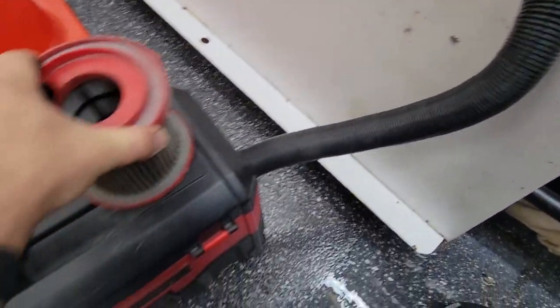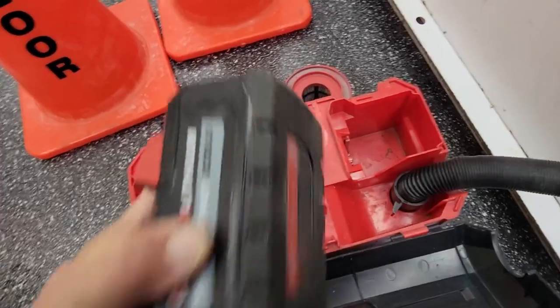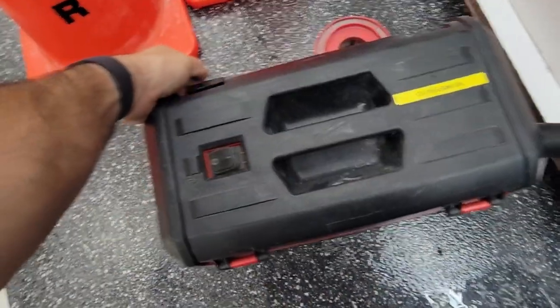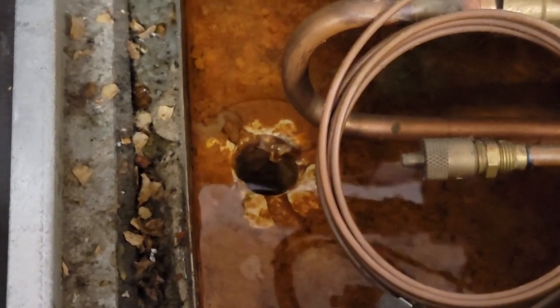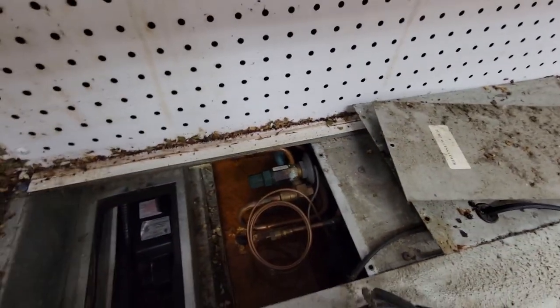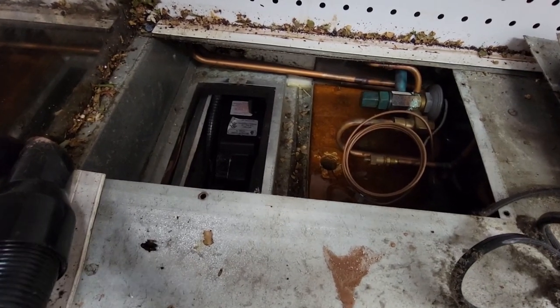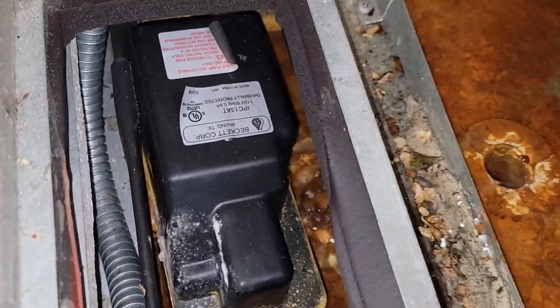There's not really that much water in that pump, so it appears most of it is right in the drain. I'm going to put the vacuum cleaner on that drain hole — it's all nasty and funky. See if I can pull that right through. There it goes, going right down in there. Let's see if it kicks on — if it does, great. We'll sweep the rest of that crud out in a second.